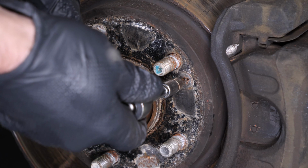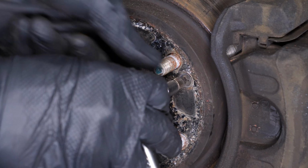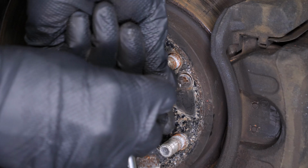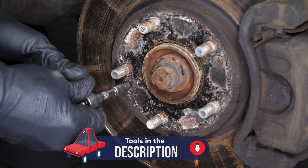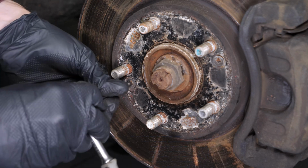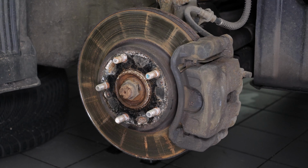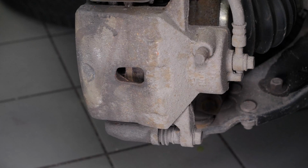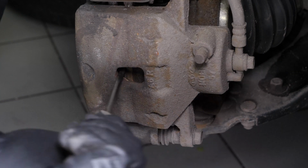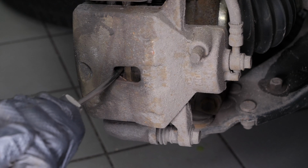Using a Phillips screwdriver, release the two holding screws on the disc. Turn the disc outwards. This will facilitate the process. Insert a flathead screwdriver to the outer extremity of the oblong hole located on the front of the brake caliper. Lift it off using the screwdriver as a lever by pulling it towards you.